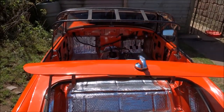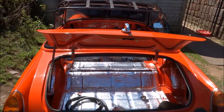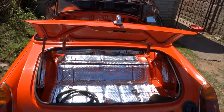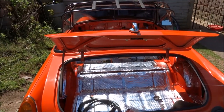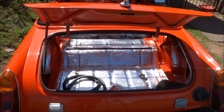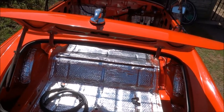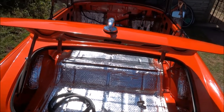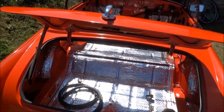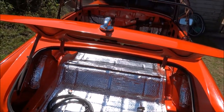It actually took me about 1 litre of paint to do the inside. So 1 litre of paint and just over a litre in primer, because I did two kinds of primer. I did a high zinc primer, and then afterwards I did, I think it's called Tetrosyl Primer, which is quite a thick base paint, and the zinc primer prevents further rust. So the higher zinc volume that you have in the primers is a lot better. And then you have a thick primer over the top. You don't have to do that if you don't wish, but for what it's worth, it cost me, I think, about £16, £18, something like that, for the primers in 1 litre. So to be honest, it's not a bad deal.